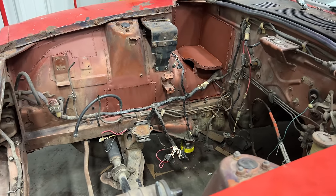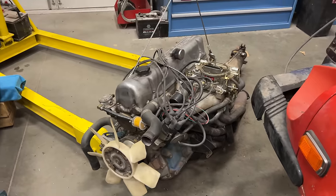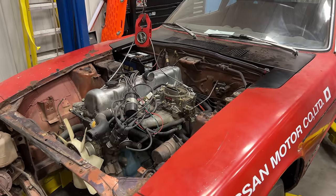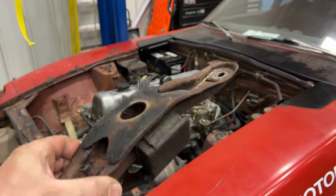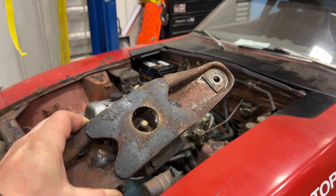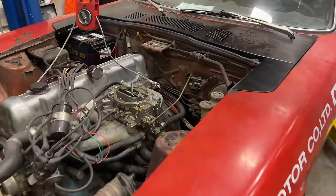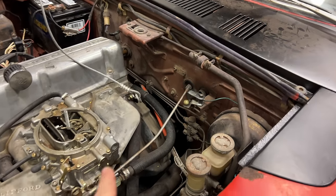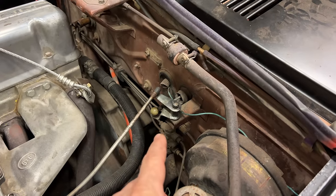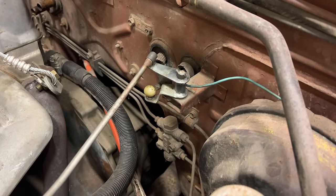All the holes have been patched and the battery tray has been rebuilt, so the new engine can go in now. The engine's now installed into the car and there were a couple of very notable differences. First would be the transmission mount — the 240Z mounting bolts go 90 degrees from those that the 280Z uses, so I had to use the 280Z transmission mount. The other thing that had to be changed was the bell crank, because I'm using a completely different style throttle. This bell crank is not only clocked differently but it was twice as tall as it is now — it had to be cut, welded, and modified in order to fit.